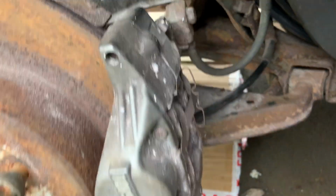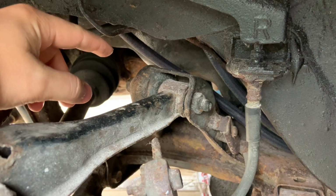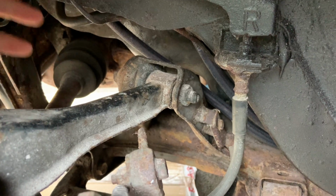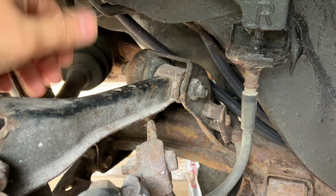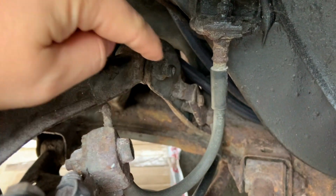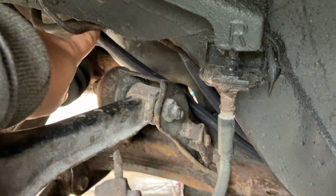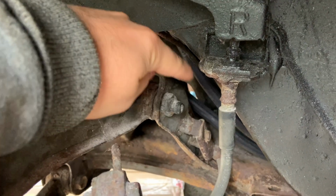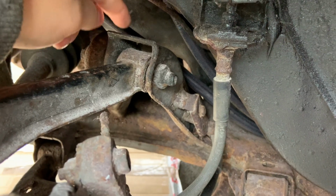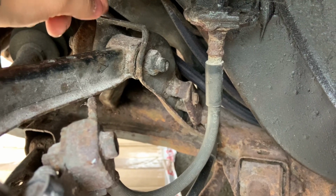So another issue that we had when we bought the 33, the previous owner had put it into storage because of a fuel leak, and he wasn't sure where it was coming from, and it just sort of stored it up. On inspection after we got the car here, we found out that the leak was coming from the hard line, where the standard rubber hose comes down and then connects to the hard line, and as soon as we touched the hard line, it literally just broke and fell away. So the underneath car fuel hard lines were absolutely shot.